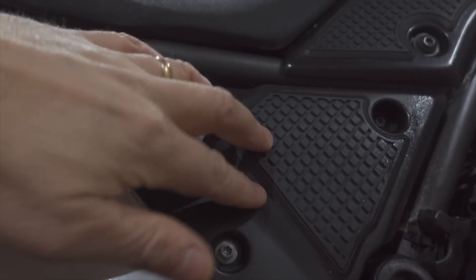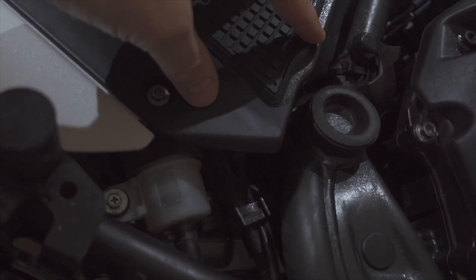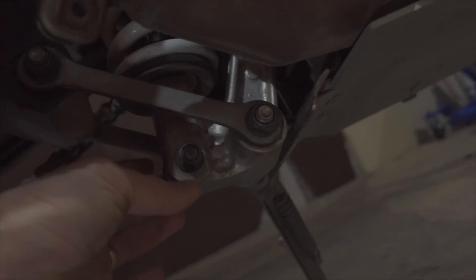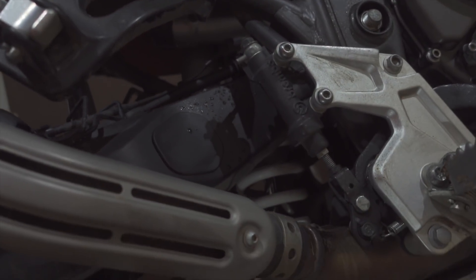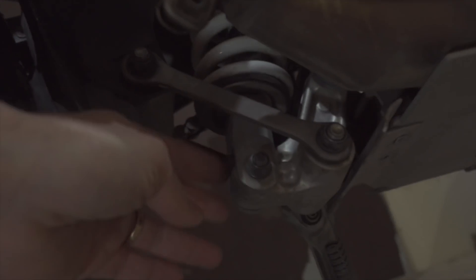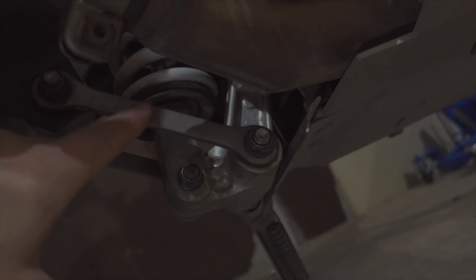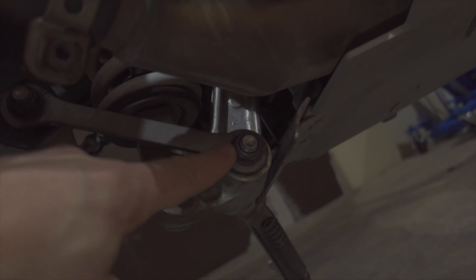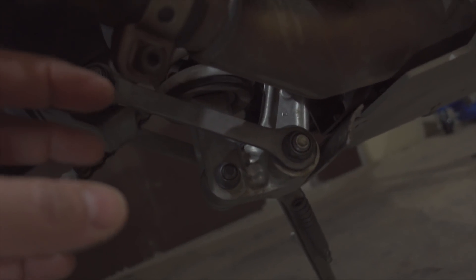The top part is behind this cover. If you want to remove the rear spring you take away this plate, unscrew that bolt, and you can take the suspension out. But what we're going to do is concentrate on the lower part and also these link arms — fastened up here and here. We'll just unscrew everything, remove the bolts, grease them up, and put them back in.